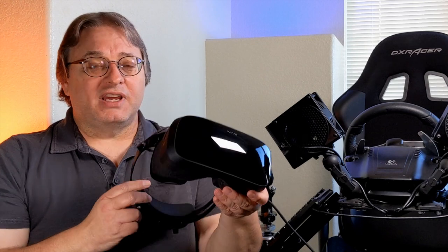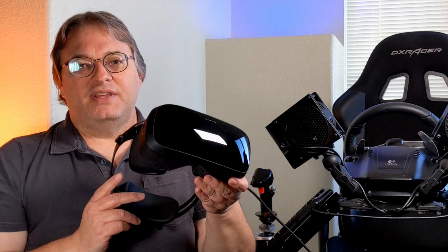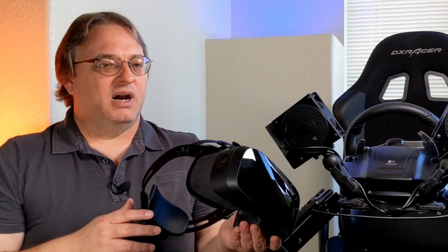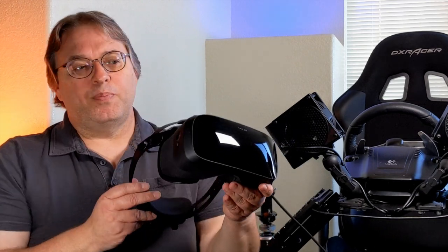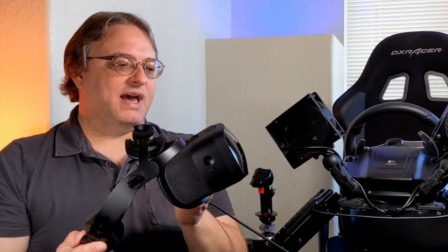Now, again, these screens are capable of local dimming. I confirmed that with Varjo. Local dimming is where you take the dark parts of an image and you basically darken that area, and then the bright spots are lit separately, kind of like what OLED does. They said the panels in here are capable of that, but they also don't know when and if they're ever going to do that. So there is hope that the actual physical screens in here could be tweaked to fix that.